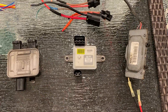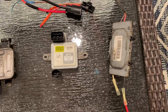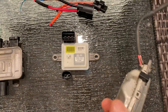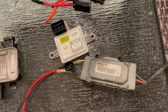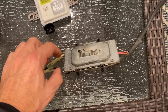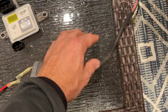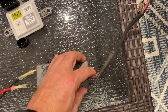These other controllers are PWM controllers that I was going to use. You can find these on all sorts of other makes and models. This particular unit is a Bosch unit and comes on Focuses and Fusions. You'll find them either with the wires coming out of the end or with an actual plug on each end. The wiring is simple: two wires to your fan - positive and negative - two wires feeding this unit, and then a single PWM control wire.